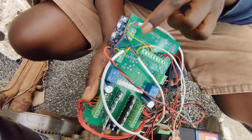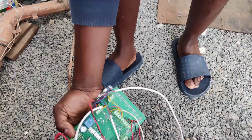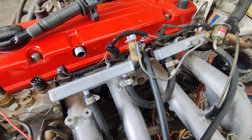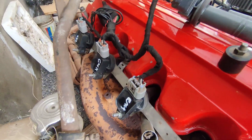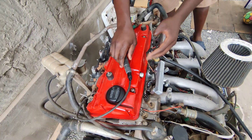I built my very own computer — this is the Votarent ECU, you can see it here. I designed it from scratch and did all the wiring. I also built a custom fuel rail — these are two half rails connected by this high-pressure fuel pipe.